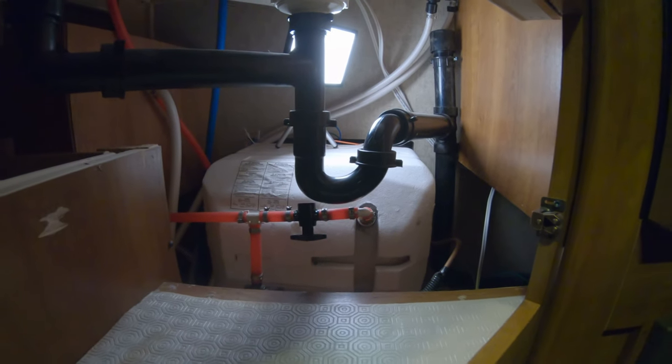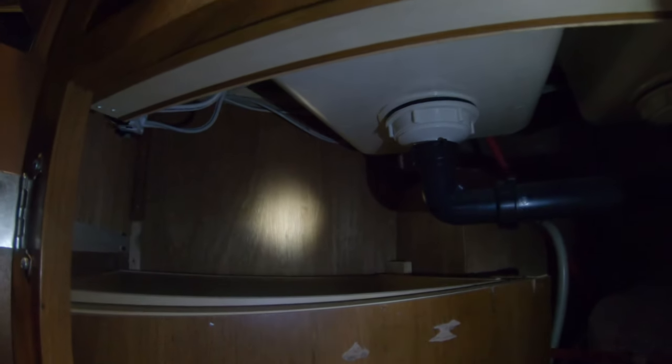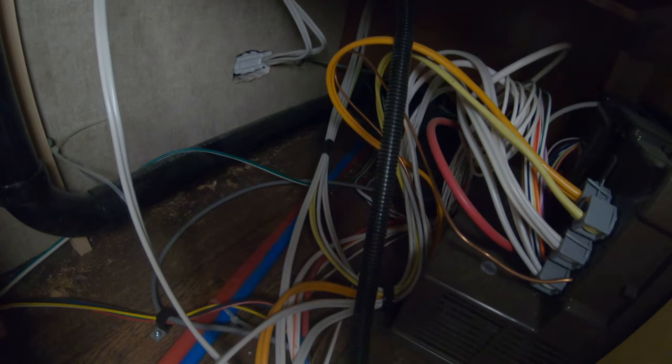There's a good amount of space, but it's right beside the hot water heater and underneath the sink, so there's potential for water exposure. The existing converter has actually been mounted up from the floor, and if we use this location, we would never put everything right on the floor — it would have to be mounted up at least a little. I'm thinking of building a small shelf above the drawer for the charger, and a shelf about two inches off the ground behind the converter for the batteries. Safety first — make sure you turn off AC power, unplug completely, and disconnect the 12-volt at the trailer's battery disconnect.